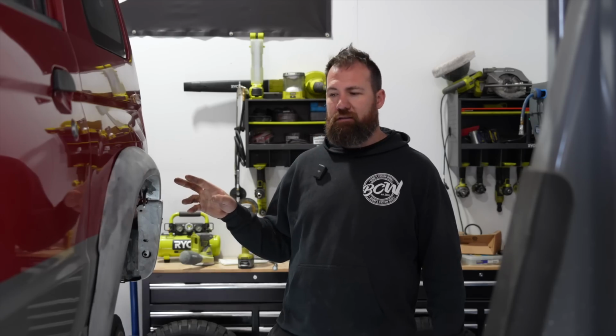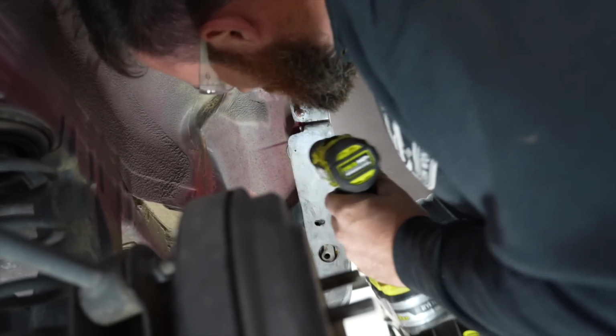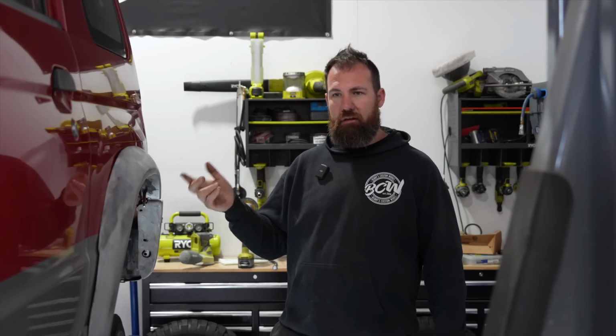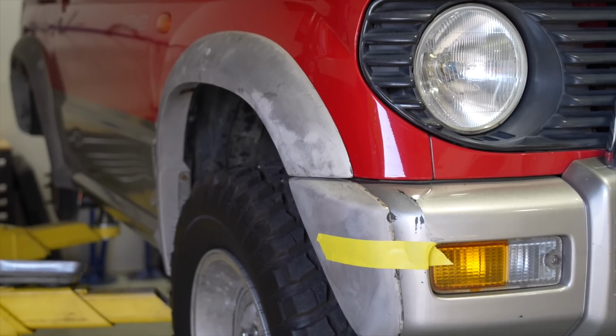We've got the rears mounted to the vehicle temporarily using Clecos. They're almost a reusable rivet. They only require a 1/8 hole, which is quite small. And I will just use aluminium rivets to rivet these back on that are also 1/8, so that'll get that sorted. The fronts are going to use the brackets that we don't have yet. We need to get those made, so that'll tie that all pretty well together.